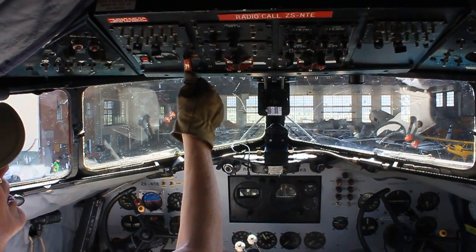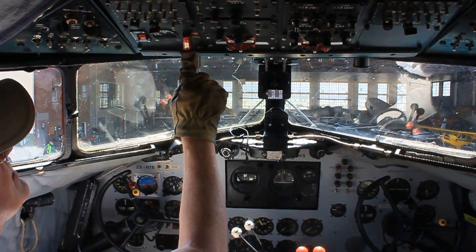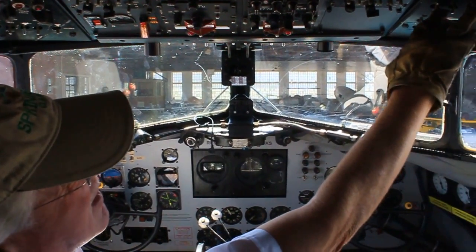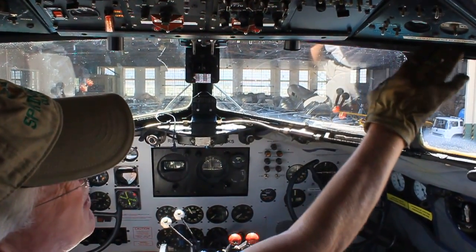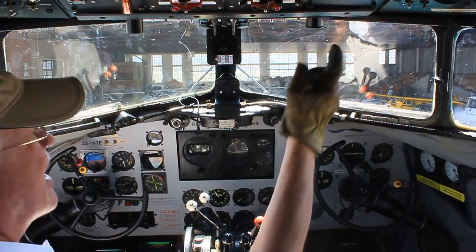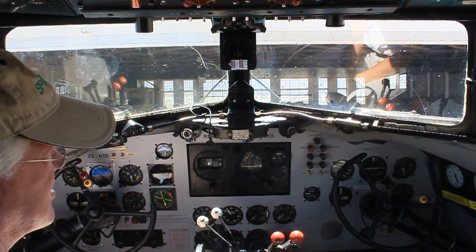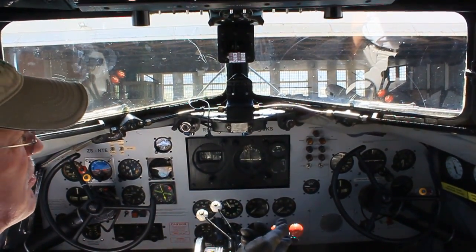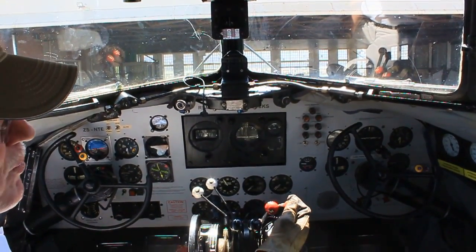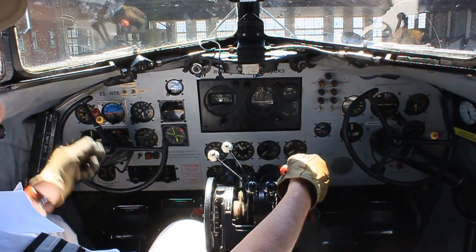Radios are off; we will switch them on only once we have started. The emergency exit lights are off, all radios are off, cockpit lights are off, and the seat belt and no-smoking sign is off. From this side I am going to make sure everything is off until ready for the start. For the hot start, make sure all magnetos are on — the engines are live.